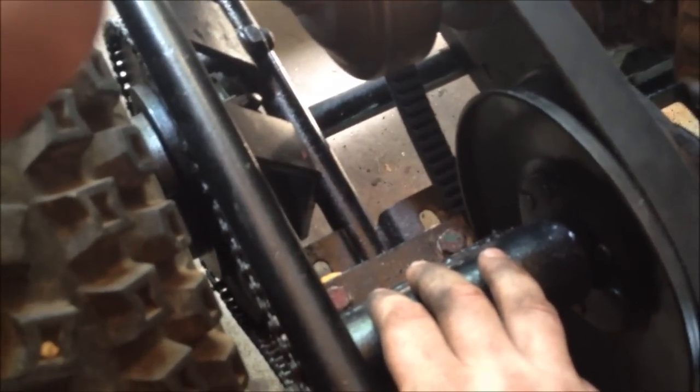I'm having a little trouble with this belt. I have the driven unit all the way back so the chain's tight, and I've had to raise it up with washers to get it even. It's still not even — this one's about half an inch or less lower than the torque converter. I may need to get more washers if I need to raise it up more.